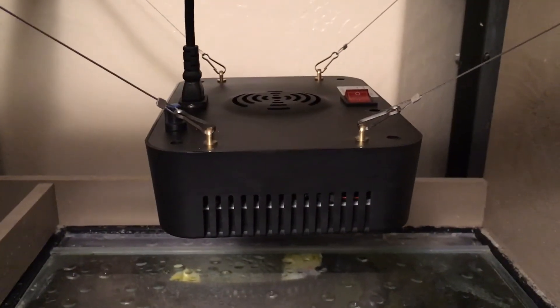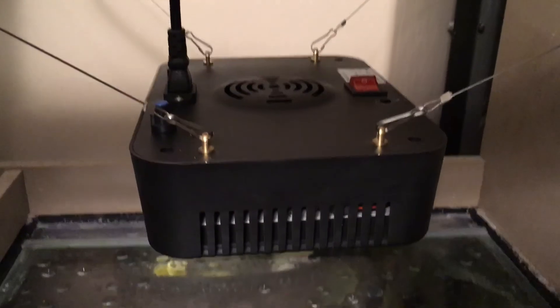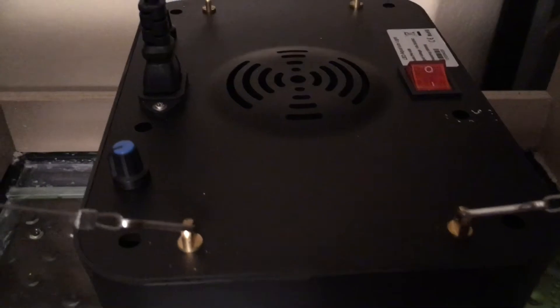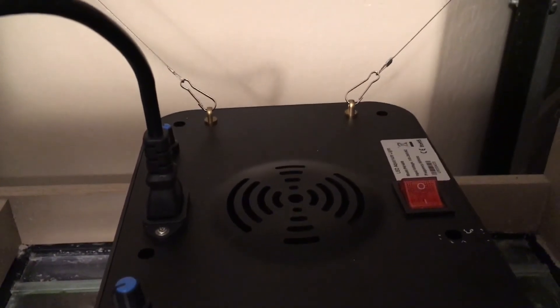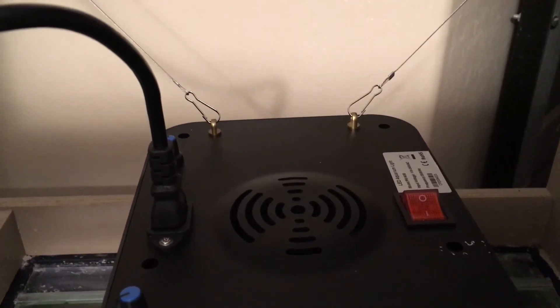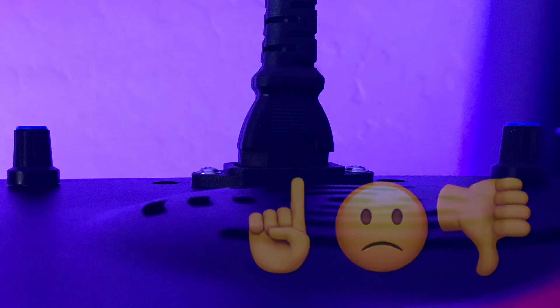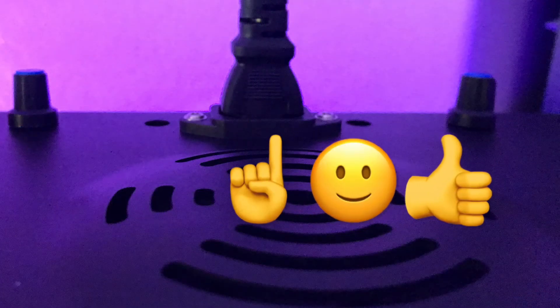As far as initial quality, I actually thought the housing was metal but it's plastic — though it feels pretty sturdy. The power switch and the two variable knobs did not feel flimsy. One small issue I had with all three lights is that the power cord going into the fixture is a very tight fit, which led me to believe I had it plugged in all the way when I didn't. One of my lights was intermittently flickering because of this, and I saw the same complaint on the Amazon page. Once I figured it out it wasn't a big deal.